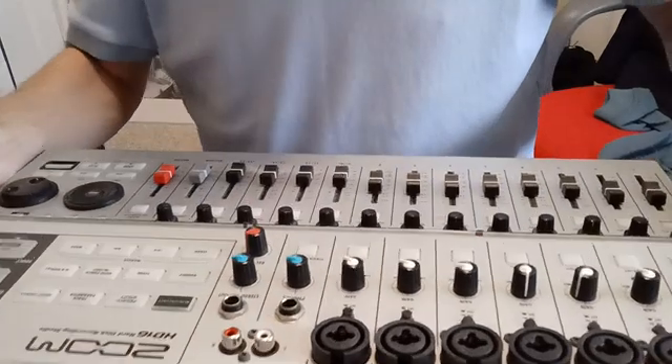Then you can connect it to your computer and do whatever you need to do to the hard drive, back it up, and replace it with another one. I'm not sure if there's an adapter to convert this style to SATA, but if there is, that would be nice. The hard drive in this one is OK. There is a built-in hard drive disk check, and also a built-in feature called factory initialize, which does not remove your data but will fix any file system errors. All of that is built into the firmware, so if the firmware is still good, you can reformat and rewrite the disk.